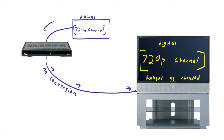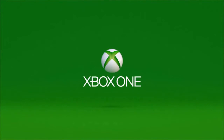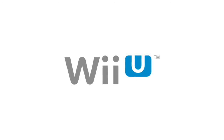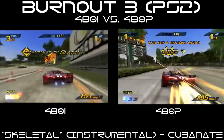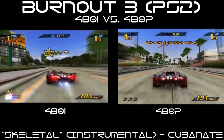Regardless of its impact on picture quality, the 1080i restriction also means that there are certain pieces of equipment that you will not be able to use with this set. Most notably, game consoles like the PlayStation 3 and the Xbox One that only support 480p, 720p, or 1080p. The Xbox 360 fully supports 1080i and will gladly scale all content to that resolution, and while I haven't personally had any experience with the PS4 and the Wii U, I believe they are also said to support 1080i scaling. The original Wii and PS2 are immune to this restriction since most of their games run at 480p, and the same can also be said for the original Xbox, although there are a few 720p and 1080-supporting titles. This is mainly only an issue for newer equipment that does not support 1080i resolution.